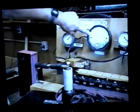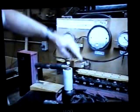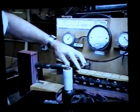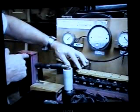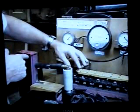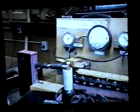You may or may not be able to see the gauge right now, but it's sitting at precisely five inches of vacuum. If I were to decrease the vacuum just a little, you'd notice immediately the Winker begins to open. And I have not decreased it even a half an inch.